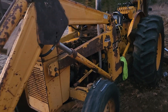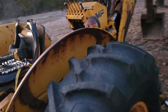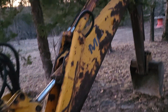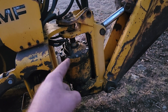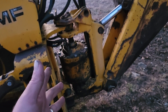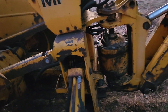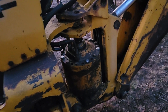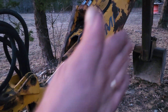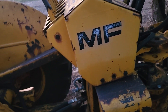Hey guys, so I haven't done a video in a while — I've been busy with little piddly projects. Last time I did a video on the old Massey here, the old '65 Massey Ferguson 203, I had fixed the rotary cylinder. Never done anything like that before — I'm not a hydraulic mechanic or even a diesel mechanic. But it was pretty straightforward replacing the seals and getting this backhoe to swing right and left again. Works perfect. This thing runs like a scolded ape.